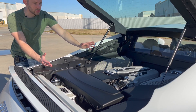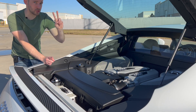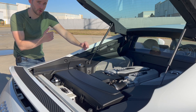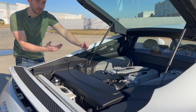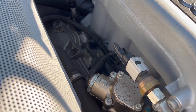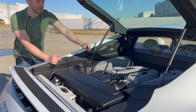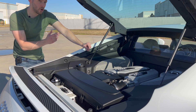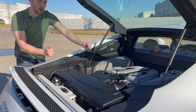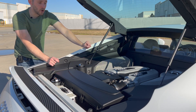One of the other interesting things about the R8 is the engine. A lot of people, including myself, used to say this is the exact same engine that's in the Audi RS4 B7 — and for the most part that's true. However, there are two big differences. This one has a dry sump oil lubrication system, meaning when you're going around a track or doing hard cornering, the engine is far less likely to starve of oil. The second difference is this engine has a single mass flywheel versus the RS4's dual mass flywheel — it spools up quicker and is lighter, but the clutch engagement is a little less smooth.